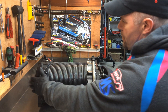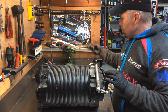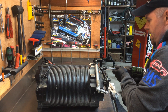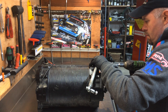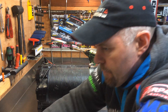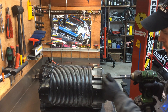I usually leave these boxes in neutral when I'm stripping them. It's not the end of the world but it's handy to remember it's in neutral so you don't have to go fishing to see what gear it's in — and I'll show you later why it's good to know what gear she's in. That's the selector mechanism removed, and that gets us at the rest of the back bolts, so we'll pull them out now.